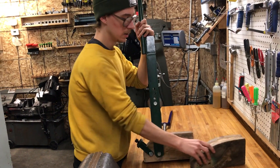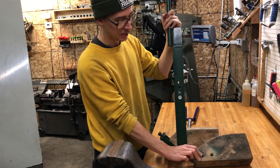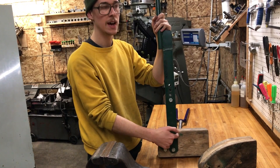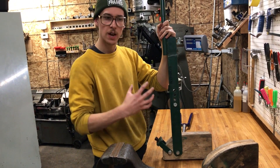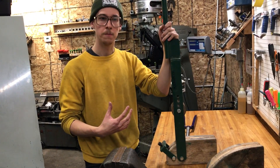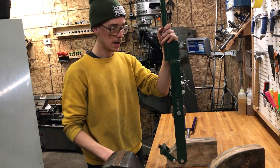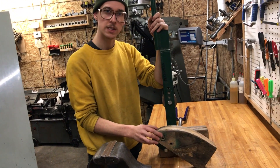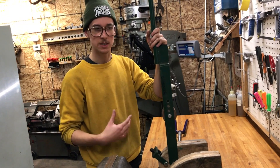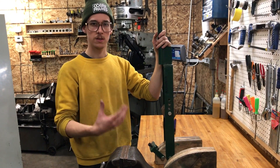I made two of these: one is a six inch radius and one is an eight inch radius. This would be the eight inch — I use this one a lot more. The six inch is for tighter radius bends, which you see more on older randonneuring bikes — more of a traditional style. The eight inch is more of the sporty 70s and 80s style; you tend to see that more on newer vintage road bikes.